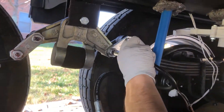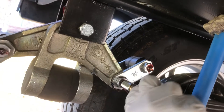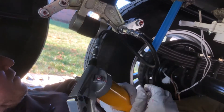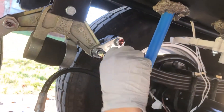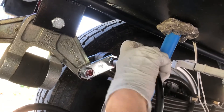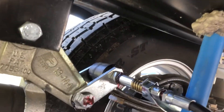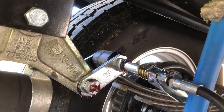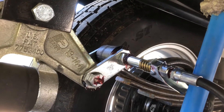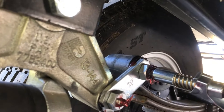Switch over to this side. Just get a little jiggle there and the teeth kind of bite it in. There you go — I see the grease pumping out right through there. This is what I would expect — around two pumps or something to see some grease. But like I say, when this thing was brand new, it was taking me like up to eight pumps. I think that one took three, and we got clean-looking grease going through there.